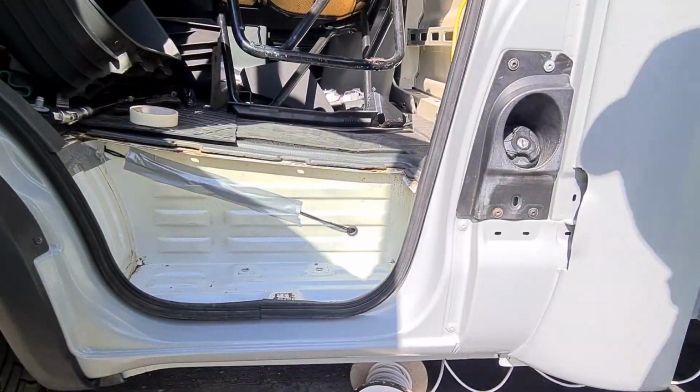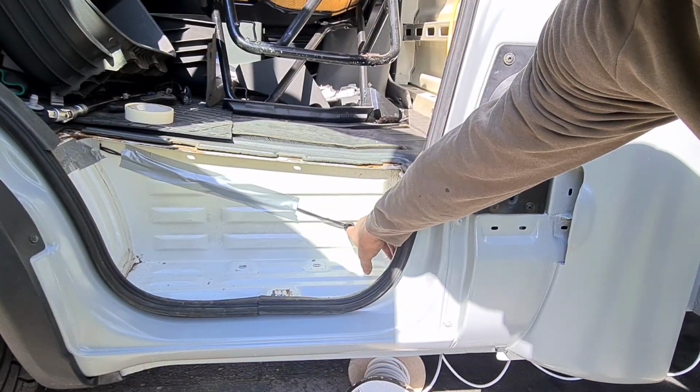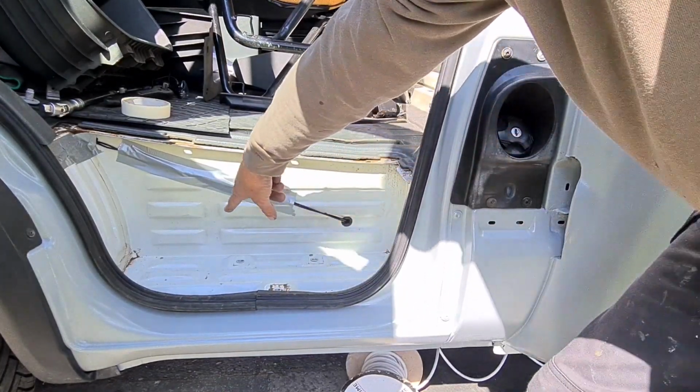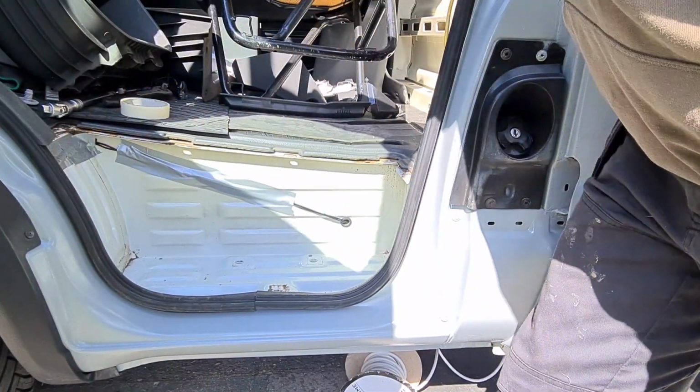So I'm going to bring the cable from up underneath the truck through this grommet here that I've already made the hole for. These are for the reversing cameras. So I'll pass it through there, through the doorstep, by the way, up behind the dashboard to my switch.